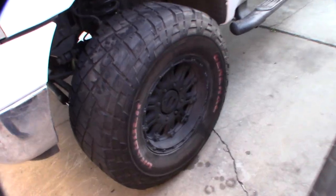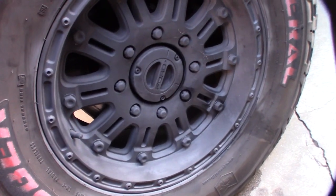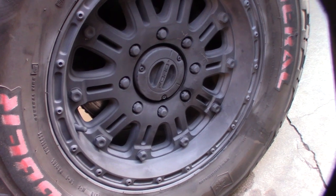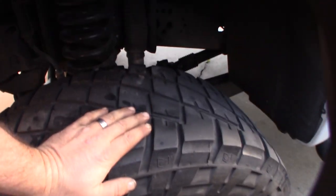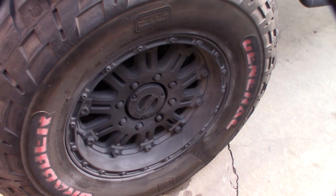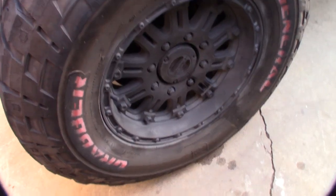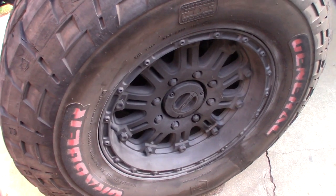All right guys, back in business here. I guess we'll see. I'll be driving this thing for the next couple days, and every time I get back, just to test it, I'll make sure the drive shaft's unlocked. If it's not, then I'll just have to get new hubs. They seem like they're functioning fine. I don't know what the hell is going on. I don't have a problem locking them in. They just lock on their own for some reason. I have no clue, so...